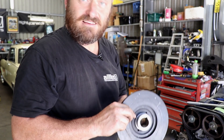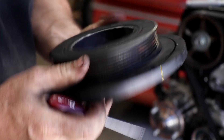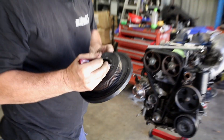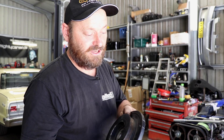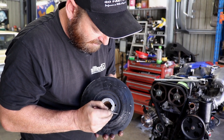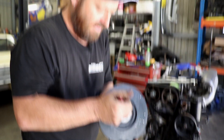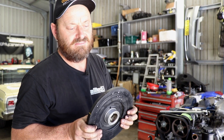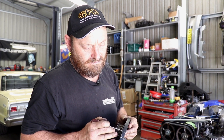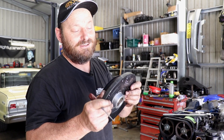When I say the pulley's spun, what we mean is this outside part here is actually not solidly connected to the bit that bolts to the crankshaft — it's bonded. This one's actually got multiple bondings and it's a harmonic balancer to get rid of harmonics in the engine. In here it looks like it's one piece but it's not — that's rubber. It's a vulcanised bonding between the inner hub and the outer ring where the belts run. That's what you're up against with harmonic balancers — they can turn over time. The bonding loses its grip. So that's why we do this. This was a really great example and I didn't expect a Toyota to have done it, but obviously they're not immune.